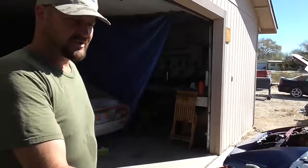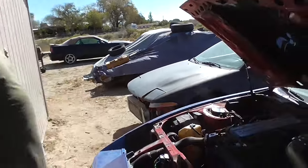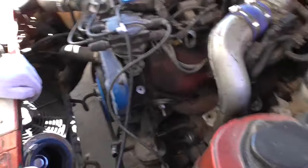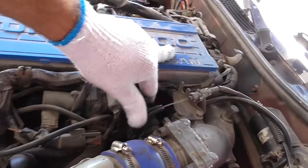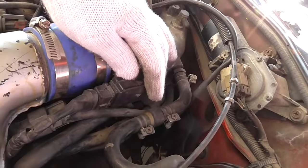Most other cars you can walk right up and find the throttle position sensor easily. We'll walk over to a Z and I'll show you how easy it is to find a throttle position sensor on most cars. You walk up to this 1986 300ZX Turbo, find the throttle, and directly across from the throttle is the throttle position sensor. Easy to find.